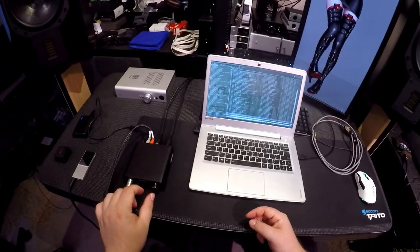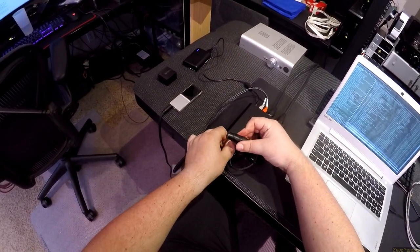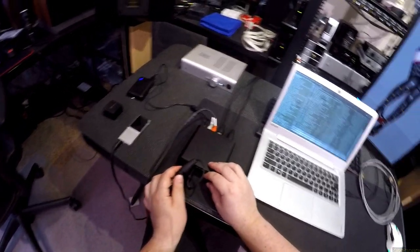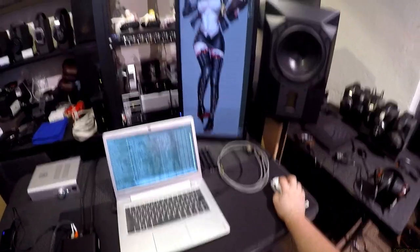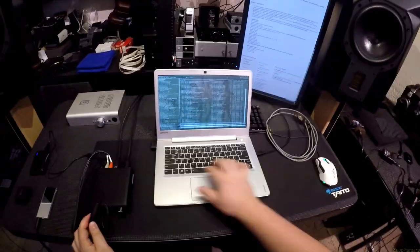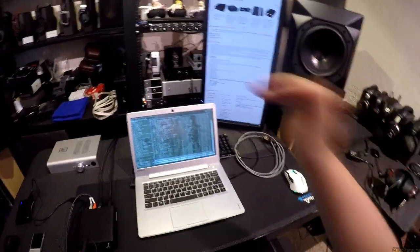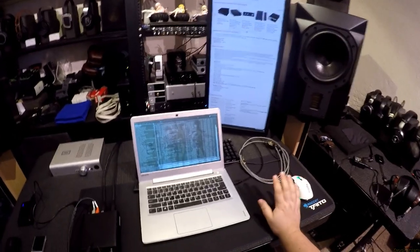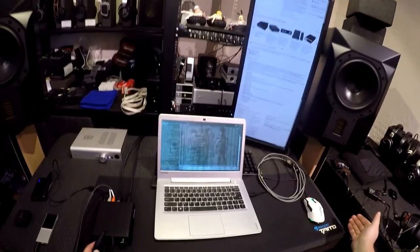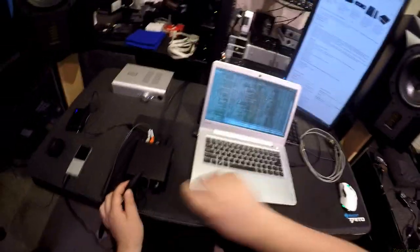Postmodern Jukebox, Clint Eastwood, 007 Cantina. Now there's a definite volume drop, because if we look at the specs, I could pause you. The unbalanced output maximum number they're showing here, 32 ohms, is 175 milliwatts, which is not a great deal. But the balanced section is 373 milliwatts. So it is a legitimate bump, at least you're going to get a 3 decibel bump. So I have to sort of take that into account in my judging.